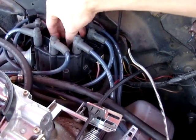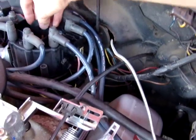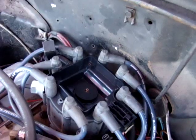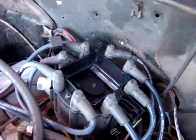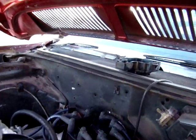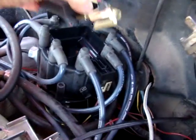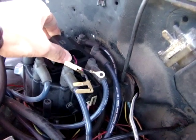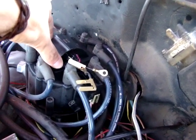This is the new one — circle side down first. Then go ahead and take the spacer and put it down so it sits in between the coil and the actual distributor. After you get the spacer down in the hole, you're simply going to take the new coil pack and place it down into the holes.